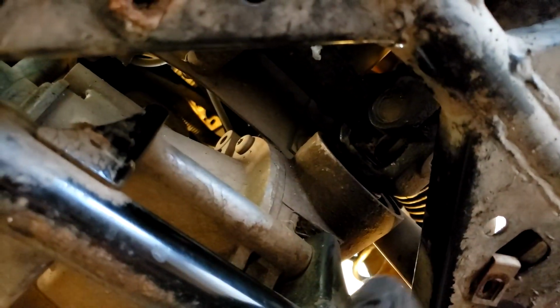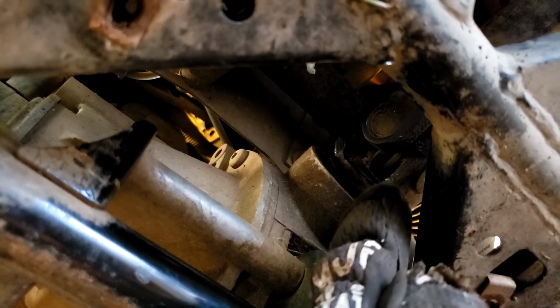Okay, you can see the front yoke there. That's where that bolt goes in. I want to change out the U-joints, so got to get this drive shaft out of there, and it goes all the way back to the motor. And I'm not moving the motor. You look at the splines, and it looks like there's enough room to just slide it back once you get the bolt out, but it doesn't seem to want to go back.